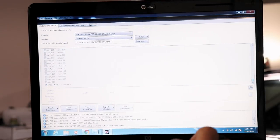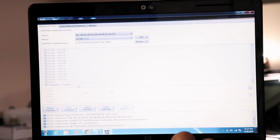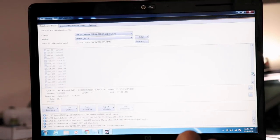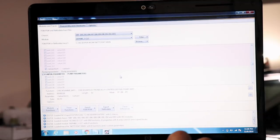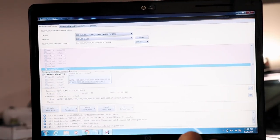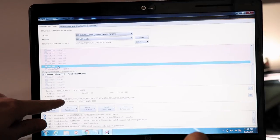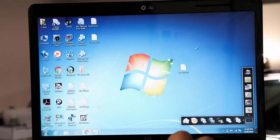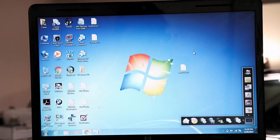Now we're going to go down to the checksum, which is 0EFD. We're going to go to my fault limits, and we have A032FF2D, which is similar to A033FF2D here. I have a file which I can push into my ECU now. So let's go ahead and do that. Fingers crossed that it all starts up after.